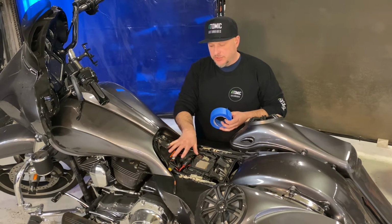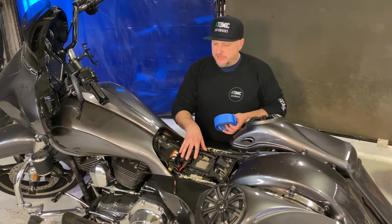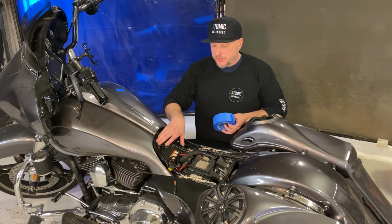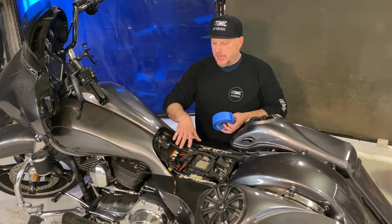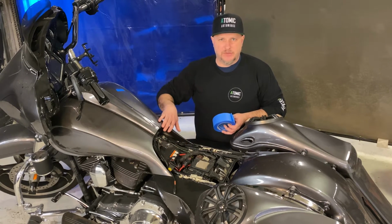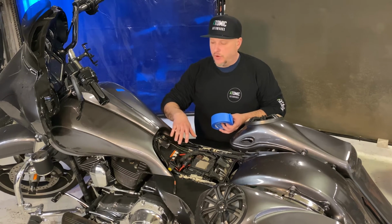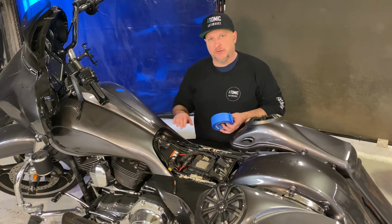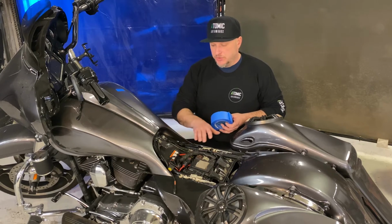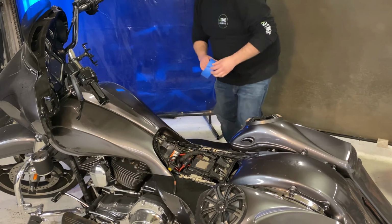This seat here has an inverted tongue, which we have to go under. We do have seat pans that already slide in here. We have some seat pans that we do for like Yaffe tanks that will fit pretty good. However, this one's so different, it's already been body worked. I want to make sure that our pan's a lot lower. Some people that haven't done the body work on it will actually have the seat pan in there and the seat foamed and wrapped, or just foam, and then they'll do their body work so you can match up to it that way. On this one, we actually have the bike already done, so we can't do it that way. So we're going to have to make our pan and seat flow right into it. Let's get tape in.